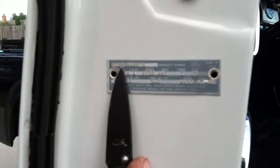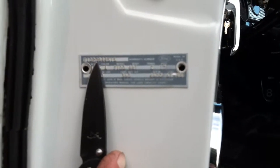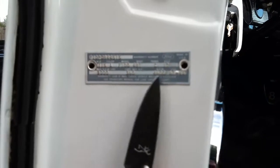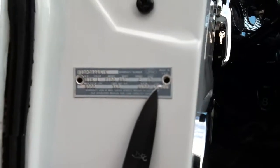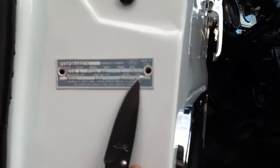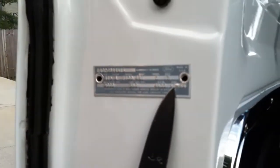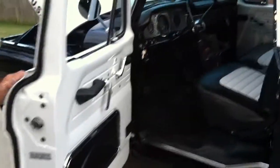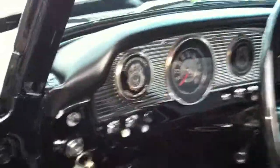On the VIN plate, the VIN shows you what engine came from the factory. The fourth digit is a P-Series, which is a P-Engine — a 428 police interceptor. The D designates what plant it was built in, which was Dallas, and the designation of where it was sent was the Dallas area. We don't know who the selling dealer was, because all the information from 1966 back has been destroyed by Ford Motor Company. There was inconsistency on units and what engines were built, so they did away with it to keep it out of lawsuits.